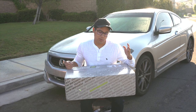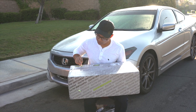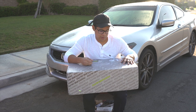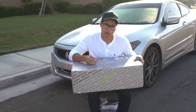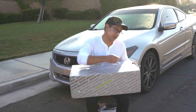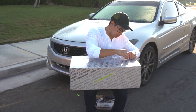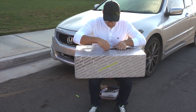This is going to be the brand of coilovers I decided to go with for the Accord. They're always praised as hand-built, and I did custom spec these. Normally they go 10k front and 6k rear, but I went 14k front and 10k rear because I want to track the car. I need a stiffer spring rate, and overall I prefer the coilover to be stiffer — when you have nice wheels you want less rubbing or damage to your wheels and body.